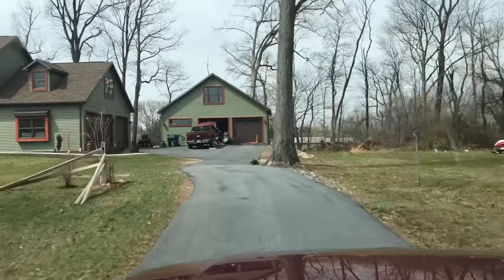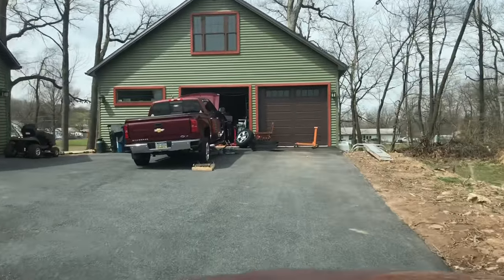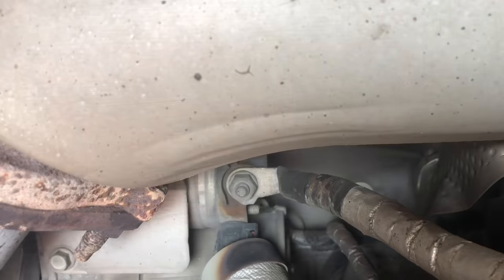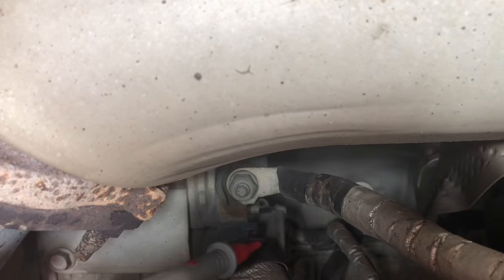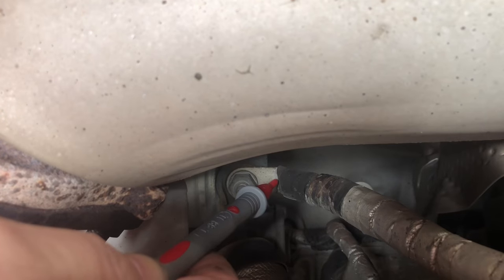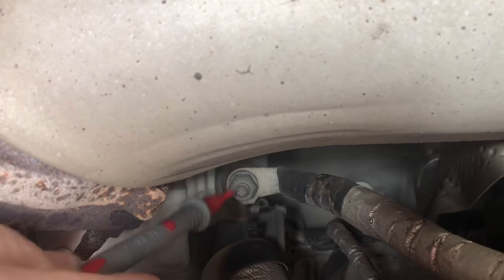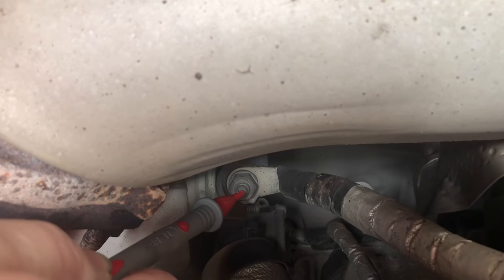The area is cleaned up and the ground cable is reinstalled. I had to go get a voltmeter — I couldn't find mine — and I need to do a voltage drop test to track down where the problems are. I've got a good known ground, and when I touch the power supply going to the starter I'm getting 12.68 volts. But when I touch the stud, I'm hardly getting anything. Let me go energize the circuit and test it.